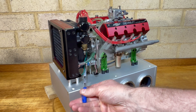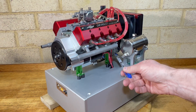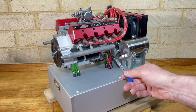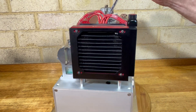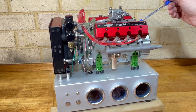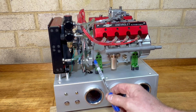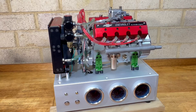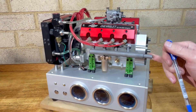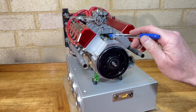It's got two oil pumps. It's got one pickup here — the filter's not connected — and there's another pump just inside there. The second pump is in behind with the pickup here, and that pumps up top through here and feeds the camshaft. The pump in the middle feeds the crankshaft.